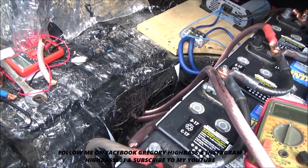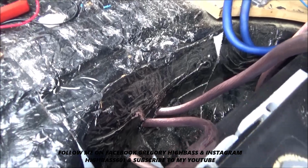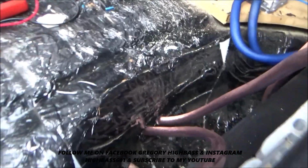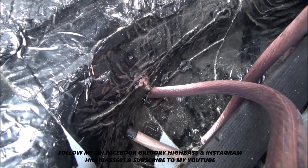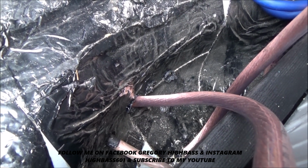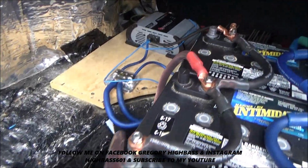And then I gotta find me some bolts to tack the ground down, and plus I got to get under the car and crimp and heat shrink the wires under the car, because the lugs that I'm crimping on the wires and the heat shrink is not going to slide through the hole. So I'm gonna have to do it under the car and then come up here and heat shrink and crimp the lugs in the trunk.